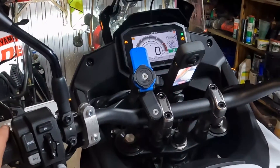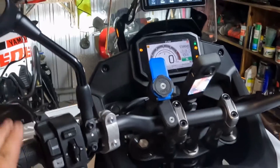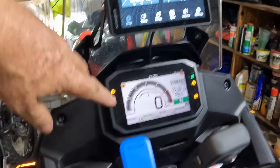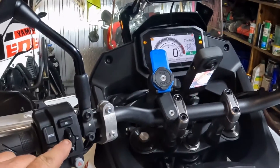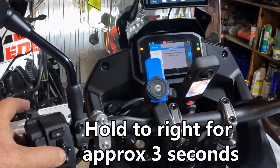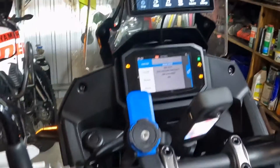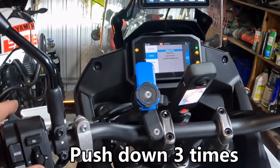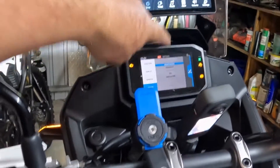What I'm going to show you now is how to get the bike to recognize the electronic equipment you're putting onto it — for recognizing the fog lights, heat grips, or quick shifter. First, switch the bike on. You'll get your standard screen and you need to go over to the equipment screen. With your left control, hold it to the right and you'll see the screen change — you now have Function, Display, General, and Service. Push it down three times to get to the Service section, which gives you Maintenance and Equipment.